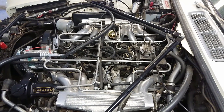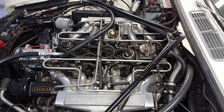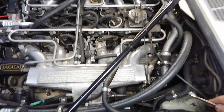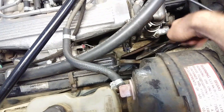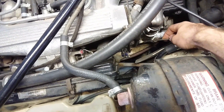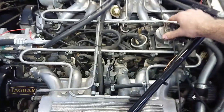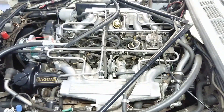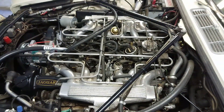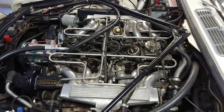Now the car is fully warmed up and I'll show you the first method — how to check ignition timing on these early pre-HEs. You need to idle down, so grab a wrench and down here on the idle valve, idle the car down to about 500 RPM. A really low idle like that, about 500 RPM. Now I'm going to grab the timing light and we'll go underneath and I'll show you how to check the timing on the pre-HE.